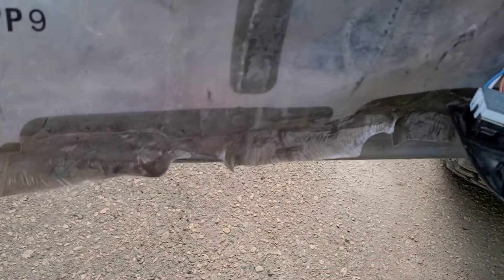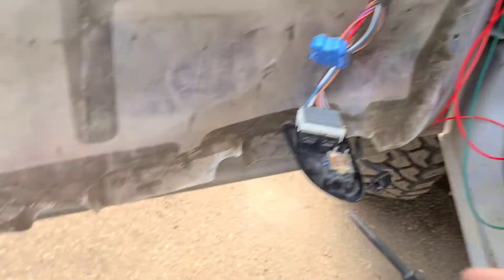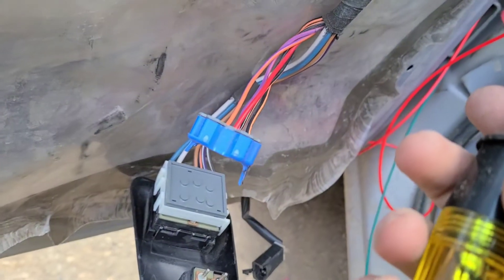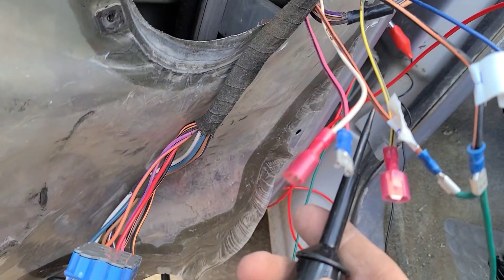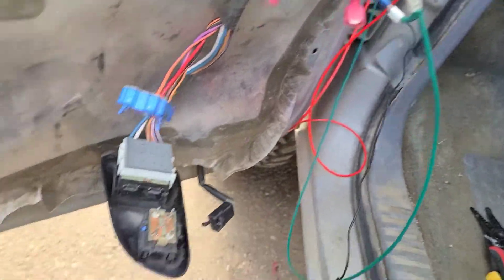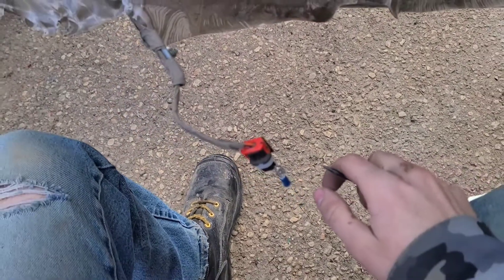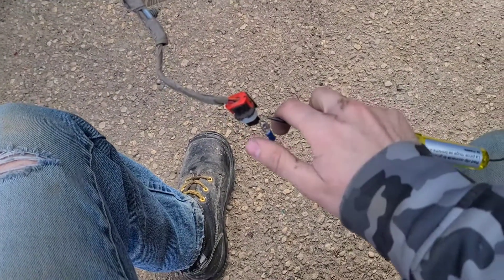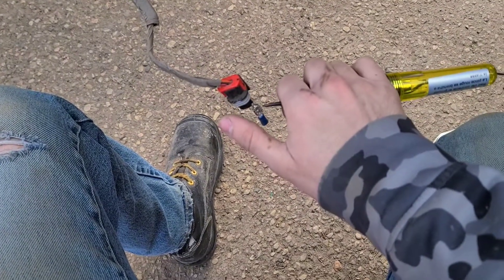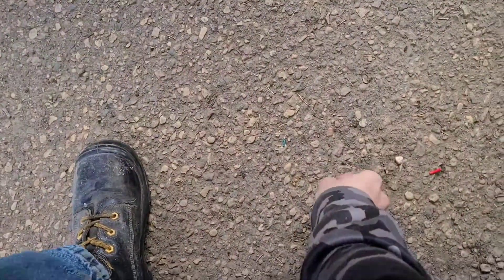So what's going on here: the test light is currently hot. I've got this black and orange wire — I'm probing with the test light and that's neutral. I'll come straight through to the plug, and either way you can see that lit up as neutral.